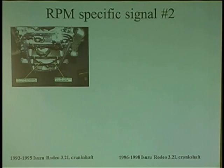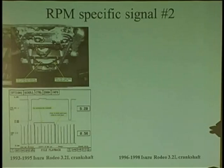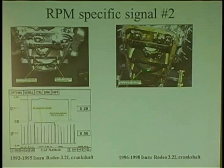And here's another one. You guys, you put a motor in, right? You did a beautiful job. You get done, it doesn't start. No spark. But you got to be visual when you're doing stuff. The guy sold them a motor that was 1 year off. Same engine, everything was perfectly identical, except for, here's the pattern it made. Look at the trigger wheel on this crank. A little different. No one looks.